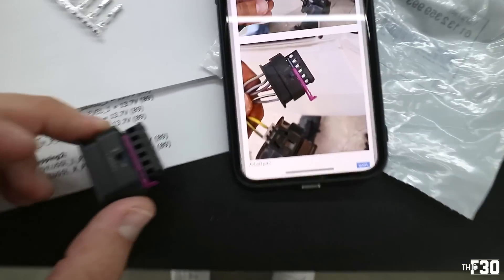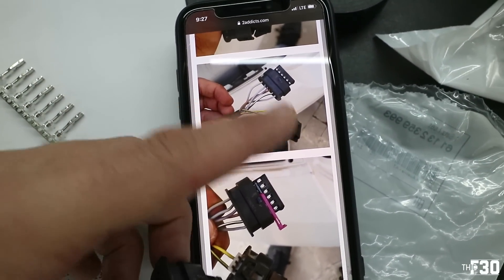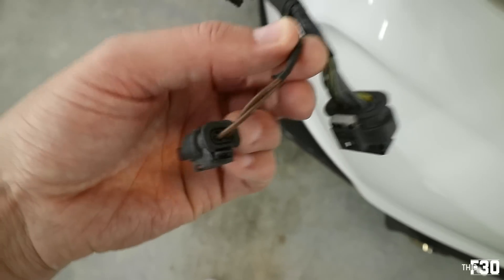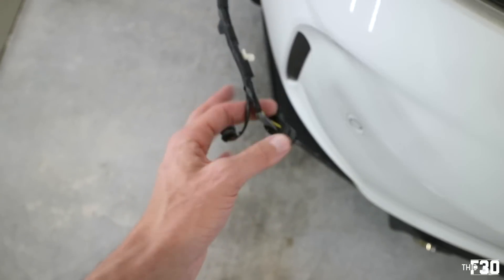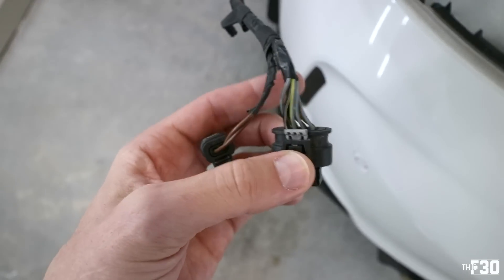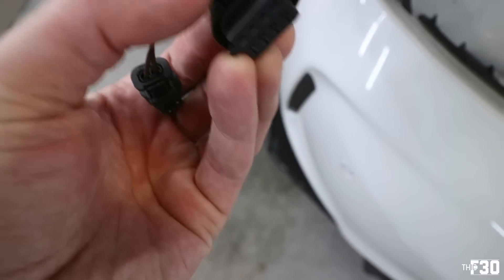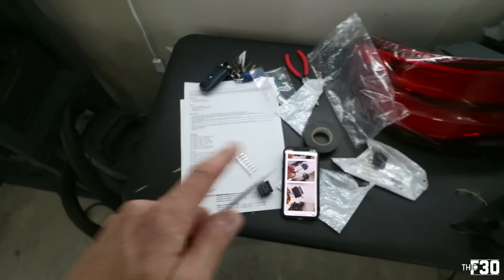Going over everything now — here's my connector and their connector and that's how you set it up. The two wires that remain in the original plug you don't use — just tape them off or let them hang. There's also a connector with two brown ones that you don't use when going to LCI, so we'll have two extra plugs hanging. You can take the wires out and wrap them with electrical tape, but we're leaving them in case we ever go back to pre-LCI. To remove the wires, use a pin pry tool to pick them out, then repin into the new one.